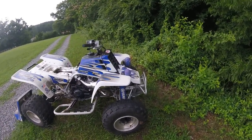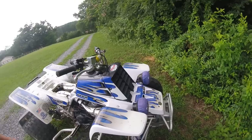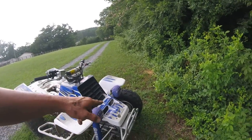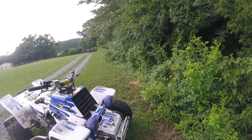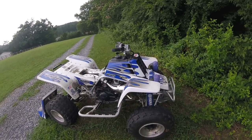But as far as radiator goes on the bike, it's a stock radiator. This set of Pro Taper handlebars. And this is a YFZ450 master cylinder. So maybe tomorrow I'll do a little video showing you a little bit of the calipers and what you have to modify to bolt the YFZ450 calipers up. And when you run the motor like this, it's pretty much a must because the brakes boil on it so much.